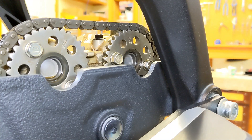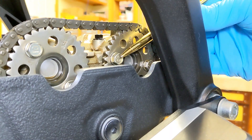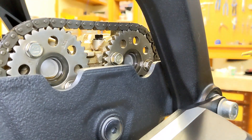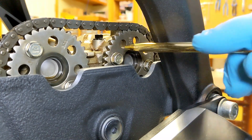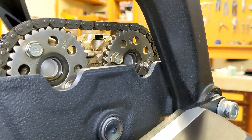If you watched the previous video — I call it a reality check — before I removed the cam chain tensioner you can see that this bolt and this bolt were level. Now you can see that this bolt is up higher and this one is down lower, so that means this shaft has rotated clockwise.